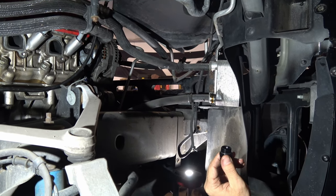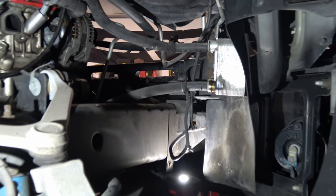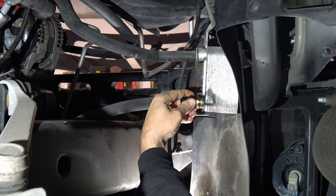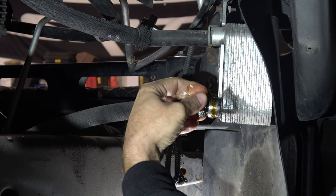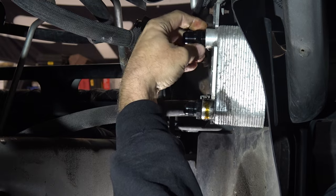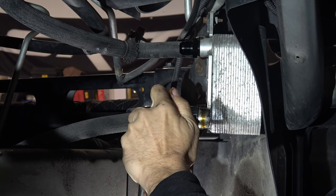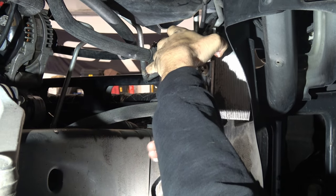In the next step, you're going to install the new fittings. Now you do want to oil the O-rings when you install them. Thankfully we have this oil source right here that we can oil the O-ring before we install them. And that is done. This is where you're going to use your one inch socket. Now you're going to want to use a socket too, because if you use an open end wrench, I can almost guarantee that you are going to end up stripping the fitting. Not to mention, we definitely want it to look pretty — since we're paying for parts that look pretty, we want them to look pretty when we're done installing them.